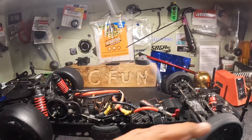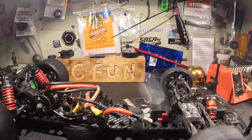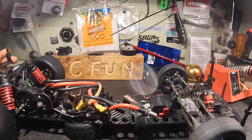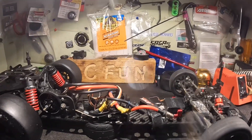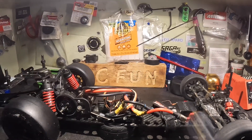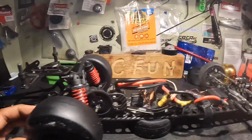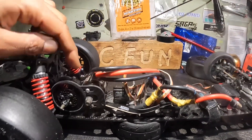Staying consistent brought me into the finals, which was a great thing for a new build — it was basically its first run in competition and it did good. I think it could use a few tweaks because as I put power down the car kept pulling, which led me to believe it was the tire. When we get this back out, hopefully we can either put both old tires on to replicate the same contact patch, or put both new ones. We'll see how it works — so far I'm liking it.